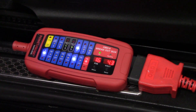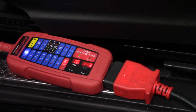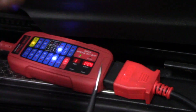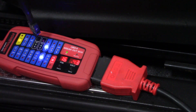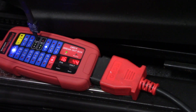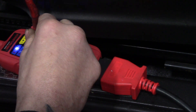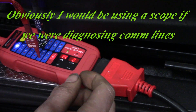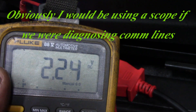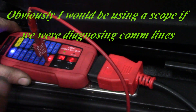I'll use my meter with the pins they provided. I'm going to go into chassis ground and then into CAN low, which is pin 14. My meter is showing 2.25 volts — so it's averaging. Going to pin 16, as you can see, 14 volts from the battery.